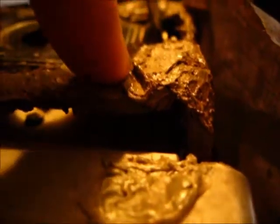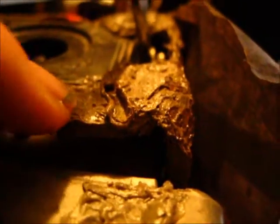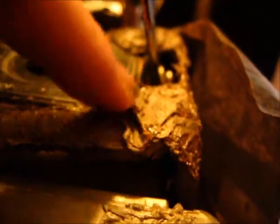Now as you see I didn't really do much to the plastic — all I did was melt a line. That line right there I'm going to make deeper in a second, but you want to make the line all the way down to the bottom where the crack is, and then you rejoin the plastic. You melt one side onto the other side and then melt that side over to this side. It's hard to show you, but I'll set the camera on top of the computer and see if you can see.